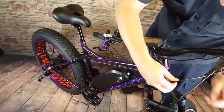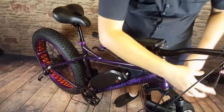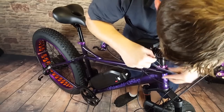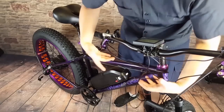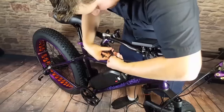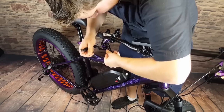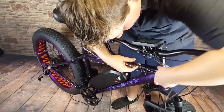Remember that you've got this brake switch over here. This one - maybe you follow along the switch that's mounted on the handlebars and then it joins together with the others at this point. However it looks good to you and the cables don't bind. So now we'll actually get started. We'll put one here and leave these just a little bit loose starting off, that way we can slide the cables around and adjust if needed.